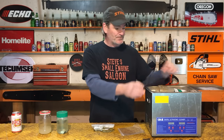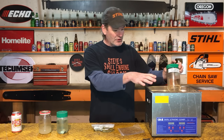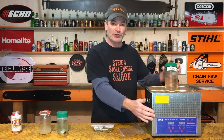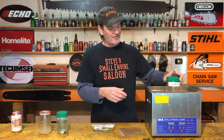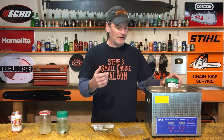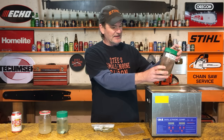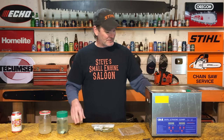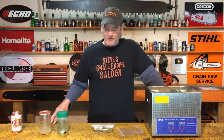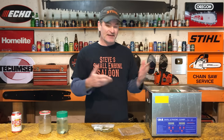I don't put the heat on. Your water in the ultrasonic cleaner may be hot because you've got your heat setting on, but by the time you put that container in there, the part is already going to be clean before it can heat the gasoline up anyway. Leave the heat setting off if that makes you feel better. Gasoline is the best thing I've ever used. If you think it's unsafe or you're just not comfortable with it — simple, don't use gasoline. Use something else.